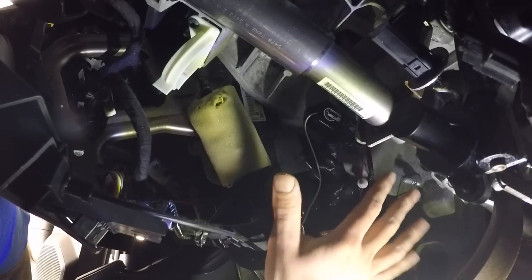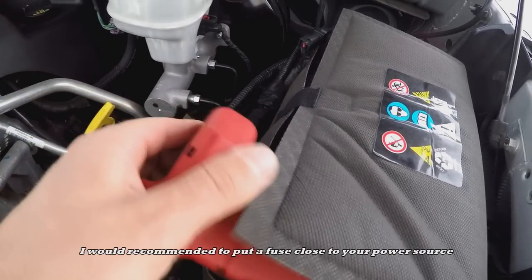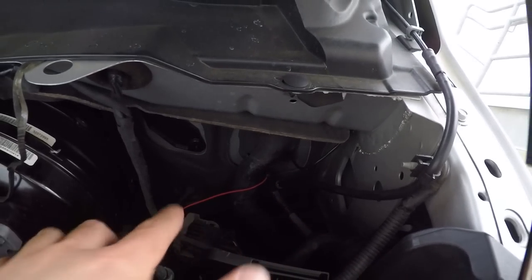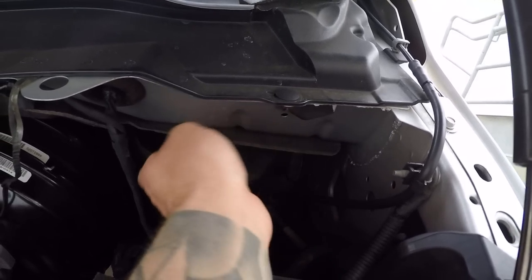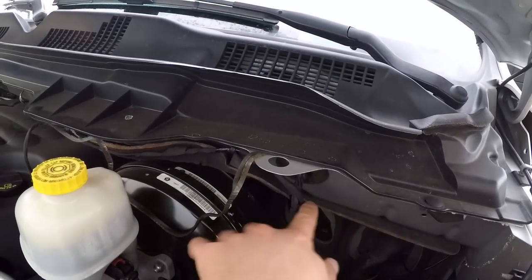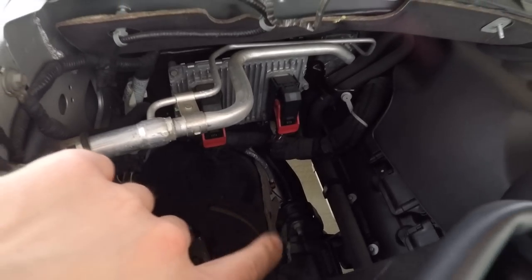Here's the finished install up top. The red wire goes onto the 10-millimeter post - very straightforward. The wire running to the cutout is tucked behind the insulation at the firewall, runs across, then down and across the frame rail. Very basic, very simple.